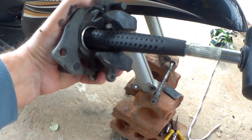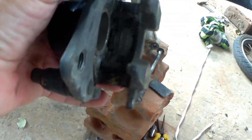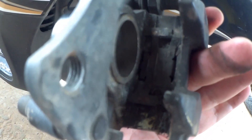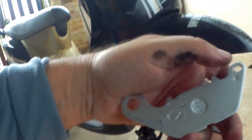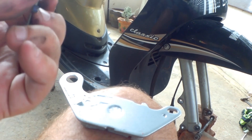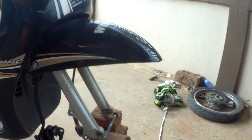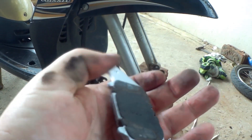While I'm at it, I'll show you how I got the piston back in. Basically I used a rubber mallet, pushed on the shaft, which pushed the piston back. Then I fitted the spring. Only goes in one way, so it's a bit idiot-proof really. The larger of the two pads has a plate that goes on the back, which just clips in — there's a little groove there, and two grooves on the top. Don't forget that.